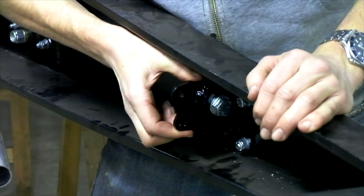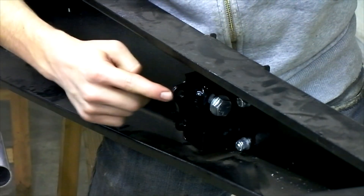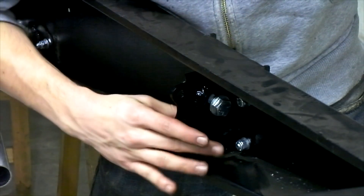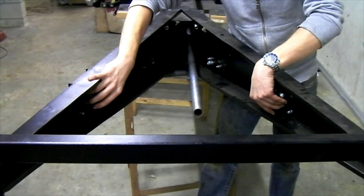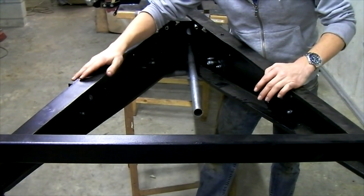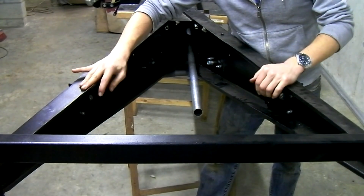You can also see that the chassis is really dirty, but even so you can see how rich this black is compared to the black of the epoxy mastic. This is also UV-stable; the other is not, so this is just a mock-up. I'm going to paint the entire chassis with the same black as I did the engine mounts. You can see how nice they fit in, and they don't stand out as an obvious modification, but this is much stronger and will last quite a lot longer. This is the view from the rear — we see the two engine mounts, both with the bolt heads sticking towards the rear. These are both installed in the original place of the chassis, so if I want, I can just change these out to original ones, no problem at all.